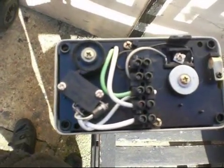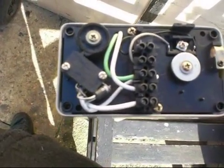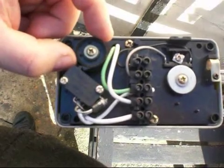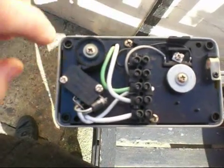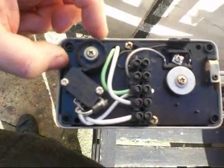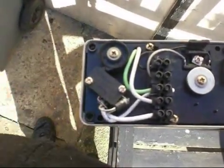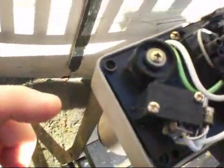Put some power to it and watch it go around in the right direction so it hits the micro switch. Now if that's going around too far, you can undo the screw, lift the gear up very slightly — only a tiny little bit, not much, because you don't want to pull it out of the back. You can twist it around and click it around a gear tooth at a time. Bear in mind there are gears under there so be careful. Go around a tooth at a time until you get it in the right position. Once you've done that one, undo the screw and move the top one, because that's actually on a little knurled gear. There is a little knurled gear between the two of them, so they're linked together and can't move once the screw's tight.